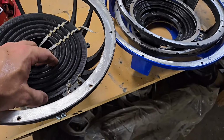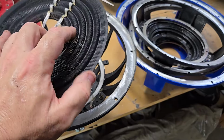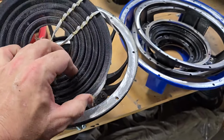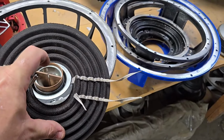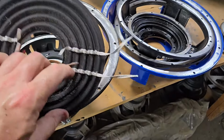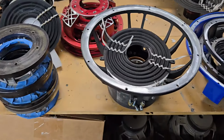So here's a couple of different ones that I use. This is the one that we had exaggerated. They just didn't trim it as much, so that way we can use it on the 10-inch TI frames. It's 8.5. And then this is our regular version. We get these in, I think, 2 5/8, and then we neck them out a little bit for the 3-inch. They're nice and soft. I really like them. I've made lots of successful woofers with them. Oh, that was a good one.